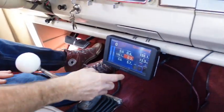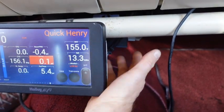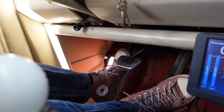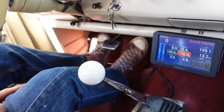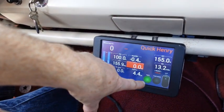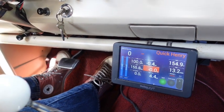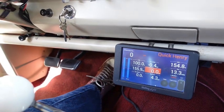I want to show you on my car how the Bankship Billy is set up. It's running through the Holley Dominator. I've got keys on right now — this light will indicate when the Bankship Billy is operating, and the controller is mounted back under here. When I push the clutch to the floor and my miles per hour is less than three, which it is, and the throttle is greater than 90% — you can watch the TPS right here — as we go greater than 90%, Bankship Billy is active and it is ready to activate the clutch controller. When one of those three things goes away — in this case, when I dump the clutch — it will activate and you'll hear it. That's how it's set up for the Holley Dominator, and that's all in the instructions.